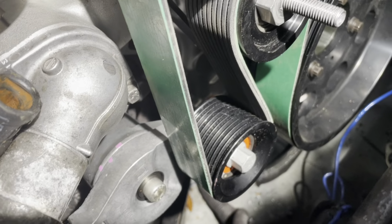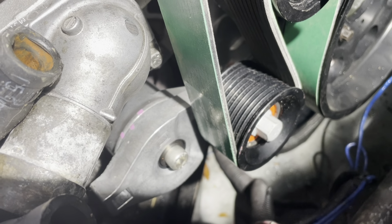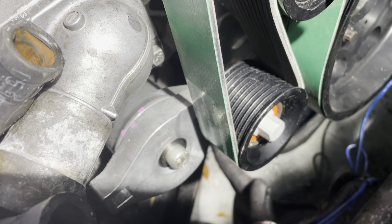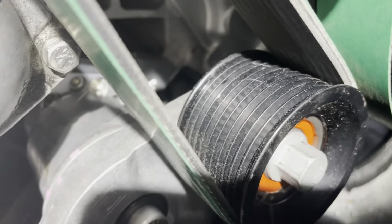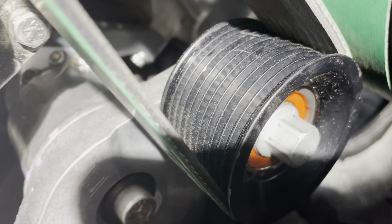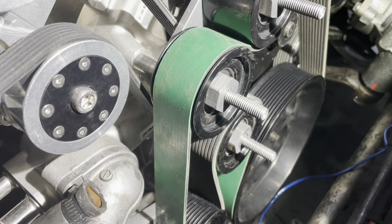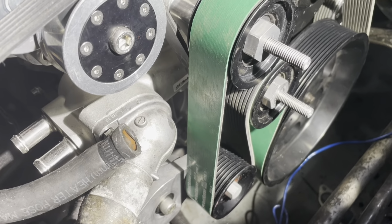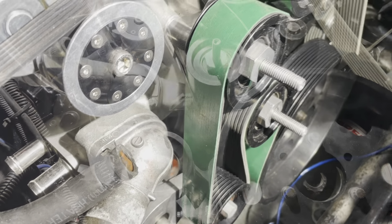The way you do that, again, if you remember, I made a few marks here, but underneath of it, there's the tensioner indicator. So I'm going to take a look at that, get that lined up. In order to do that, remember I said there's a fine grain adjustment. That's going to be on the cloverleaf piece there. So we're going to move it two positions and get a little bit more tension, which is about, I think Greg said about 3/16 for every position in the cloverleaf adjustment. So we'll change it from number 3 to number 5 and see how that looks.